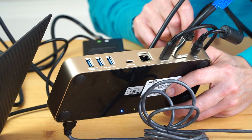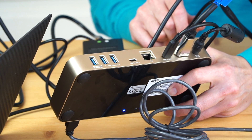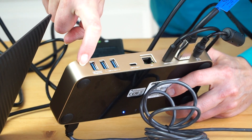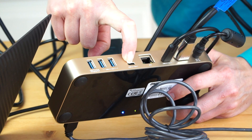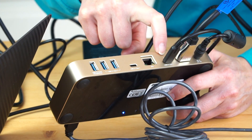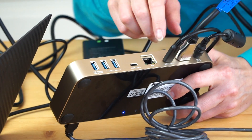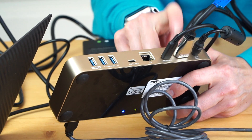USB-C doesn't speak for what kind of interface is behind it. For example, the MSI GT72 Dominator Pro had USB 3.1 Gen 1 ports that were typical USB-A ports. There's also a USB-C port in case you want to connect a USB-C peripheral, and another USB-C port marked with a computer icon that connects to your Mac. We also have Gigabit Ethernet and an HDMI port connected to an Asus IPS Full HD monitor — that HDMI port can do 4K up to 30Hz, which is the limitation of the Mac anyway. This is HDMI 1.4; you need HDMI 2.0 for 60Hz at 4K.